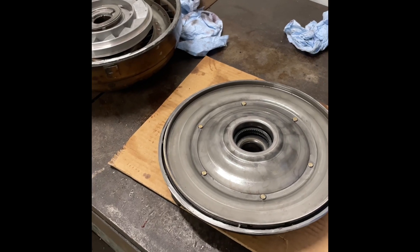The moral of the story is: if you catch a torque converter failure in time, you might be okay. I've driven the truck and it actually drives great - shifts better, drives really good. I've put about 50 miles on it so nothing crazy, but I think we're in good shape. If you have a low-mileage Silverado, Suburban, or Tahoe and you're a little concerned, go ahead and change out the converter. My wife's Suburban has the same 6L80 transmission and torque converter with more miles but no issues yet - we'll see.